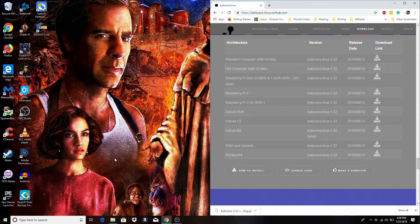The RockPro64 is one of my personal favorite single board computers. It's way more powerful than the Raspberry Pi 3B+ and features a Rockchip RK3399 processor, which is a hexa-core chip with dual ARM Cortex-A72 CPU cores and four Cortex-A53 cores. For graphics it's rocking a Mali T860 MP4 GPU. You can get it with either 2GB or 4GB of RAM — I'm running the 4GB variant — and it also has a 40-pin GPIO header and an eMMC module socket.